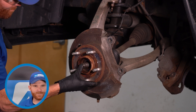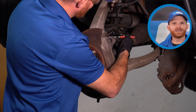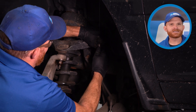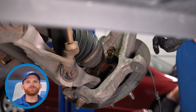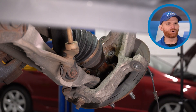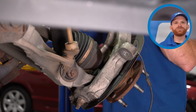We're trying to break it free from the wheel bearing. Once that's broken free, you're going to continue on to the ABS wire. Typically, you'll find that mounted to the brake hose in some way, and then it leads all the way up to an electrical connector. Go ahead and disconnect that and give both sides a quick inspection. On most applications, you can just twist that knuckle one direction or the other and gain access to the three mounting bolts on the backside. Those are the mounting bolts that are holding the wheel bearing to the steering knuckle. You can go ahead and remove those.